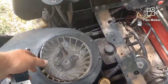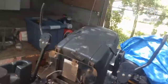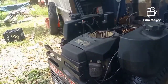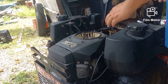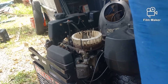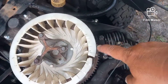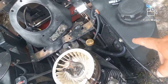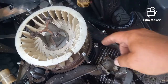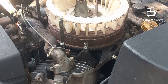I'm going to take this cover off — I left this part unbolted. You can see there's one magneto, and the other one goes right here. I'm going to bolt it in place with these two bolts. I'll set the gap with my business card — magnetos don't have to be a scary thing.